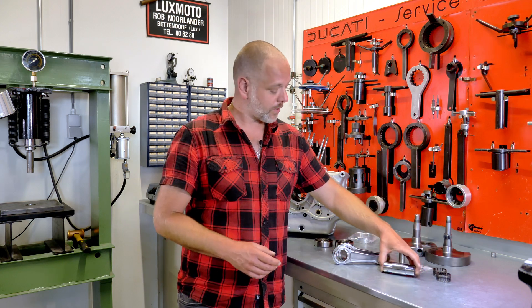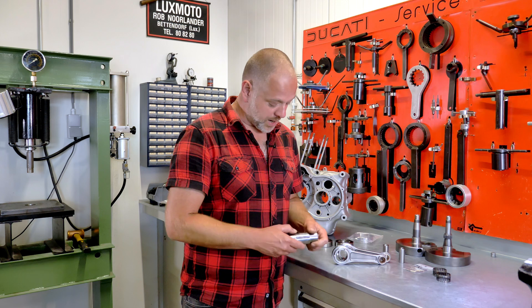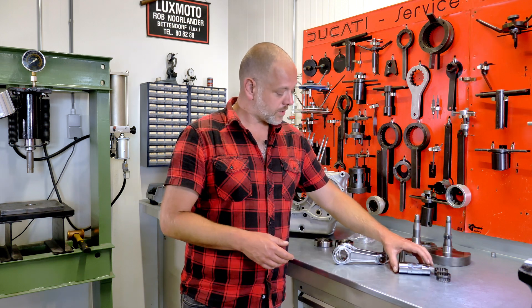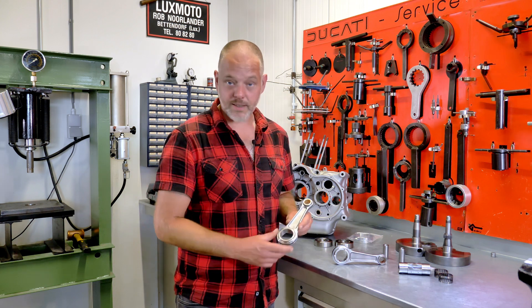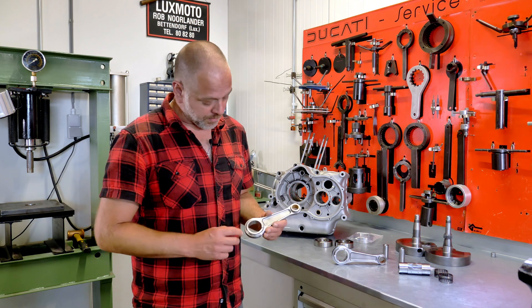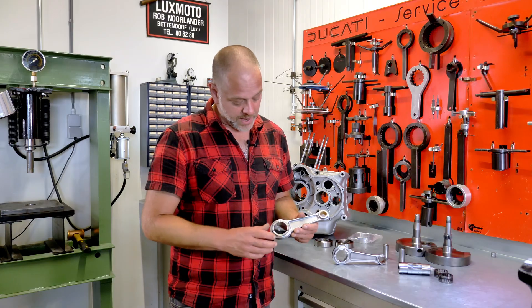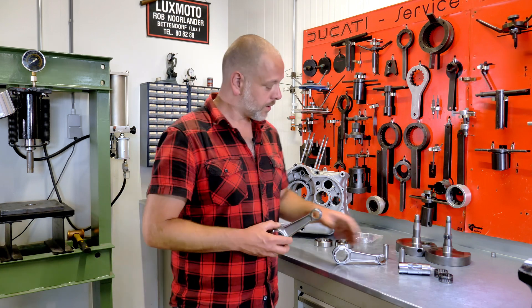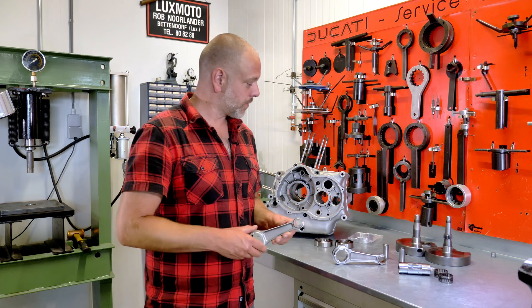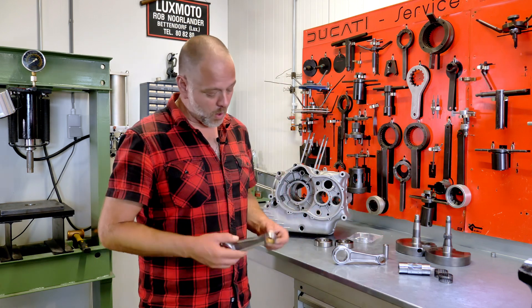Something that really set this bike apart, especially in 1974 — machined conrods with these strengthening ribs, beautifully made. The fitment on the bearing is really within a very small tolerance; we're talking thousandths of millimeters for the clearance range. So we got this pin newly made and newly ground to the correct size, with new bearing rollers and original cages. We also had to make sure the big end diameter was within specifications, which is why we fitted a bearing steel ring that is crimp-fitted and then honed to size — exact specifications within a thousandth of a millimeter.